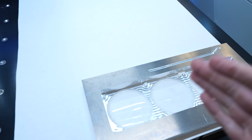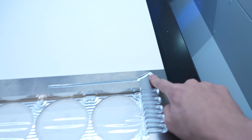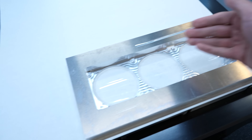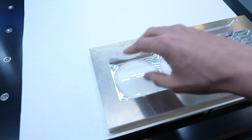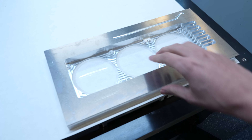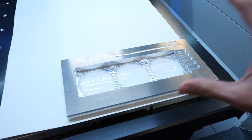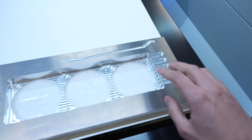Just in that very specific moment the camera was obviously not running. You can see we had a fail right here — the part is mounted on this vacuum table, and when milling away a lot of aluminium in between, especially around those cutouts, the vacuum was not strong enough anymore to keep the aluminium part on the table. We had a tiny accident, but now everything should be fine — we just added some sticky tape to fix it.